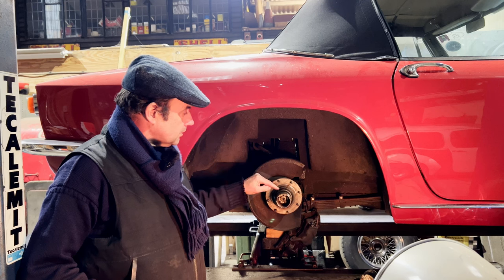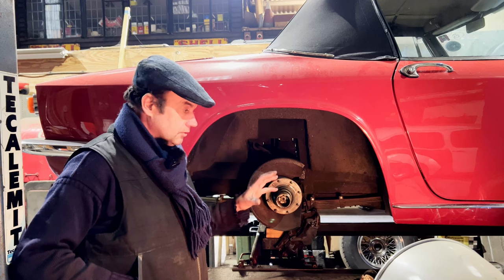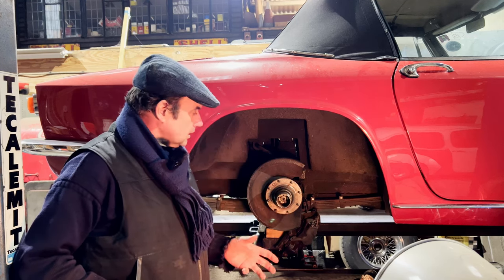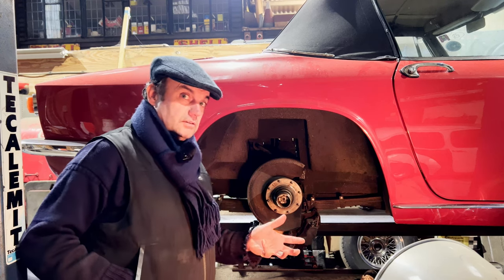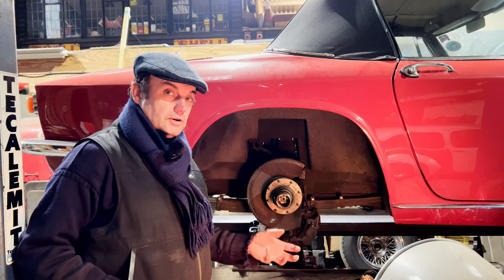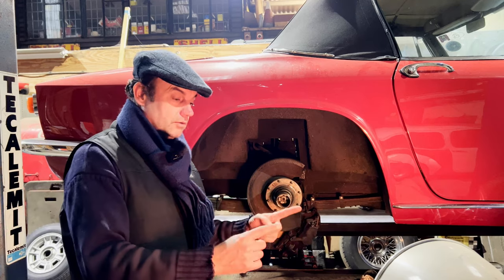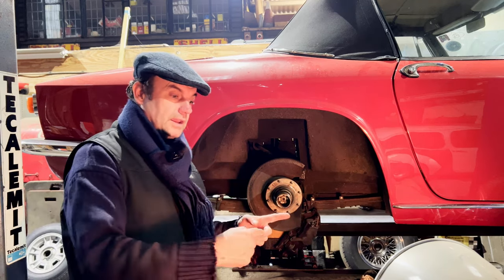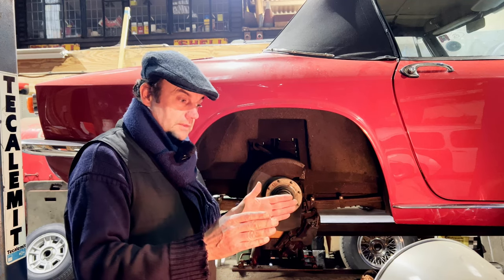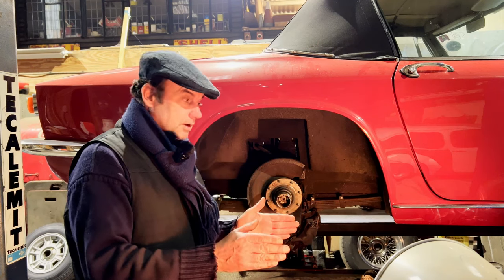It's a lot shallower than this taper. Great long taper, and they are very strong tapers in engineering terms. That's what they're there for. The old veteran cars didn't use threads on everything. They'd use a lot of tapers to hold the chassis together and the springs on. You'd have a long reamer and a tapered rod, and you'd whack it in there, and that's how it worked, on an interference fit, or there's a better name for it. The friction of that taper would hold it together.